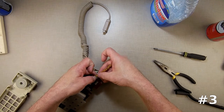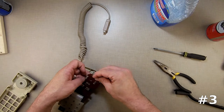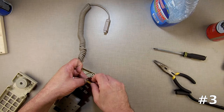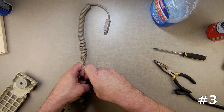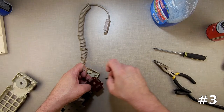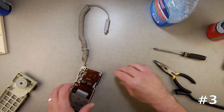These little metal springs — I've had controllers come in where the metal springs had rusted somehow, and these metal contacts, these flexible springs, had rusted and broken. Now, if you have a parts board — like a controller that is just totally beyond usable — you can remove them and transfer them to a good one. It's not that hard. It's only held on by a blob of solder, blob of solder. So you can do that.